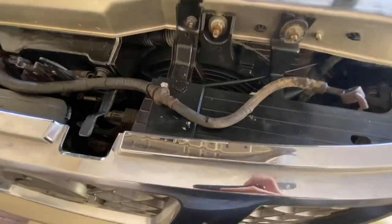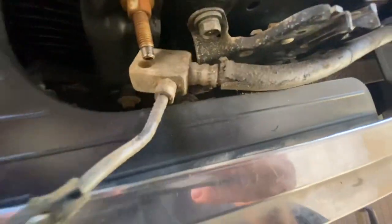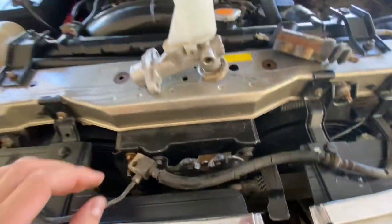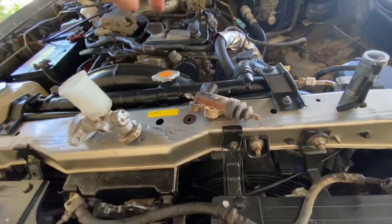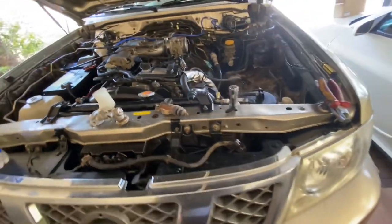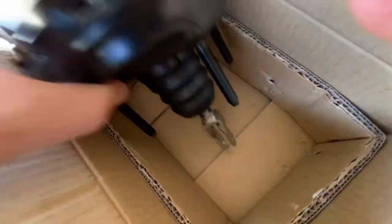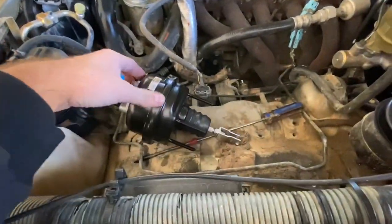And then when I went to collect it, the clutch actually failed. I believe it was this line, which on some points is quite cracked open, which is the connection between the master cylinder for the clutch and the slave cylinder, which is connected at the bottom to the clutch fork. We lost all hydraulic pressure and it was almost impossible to push the clutch in. So we then also ordered a replacement clutch booster, which we're gonna install just to make sure that we have a nice, soft and smooth clutch engagement.